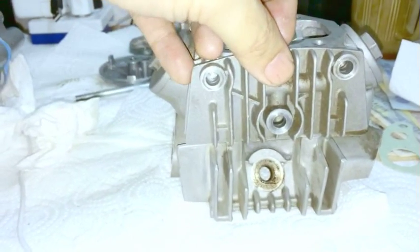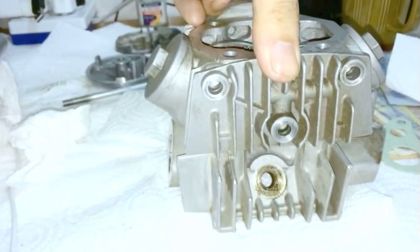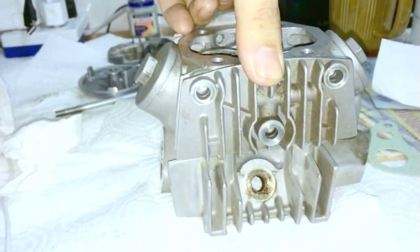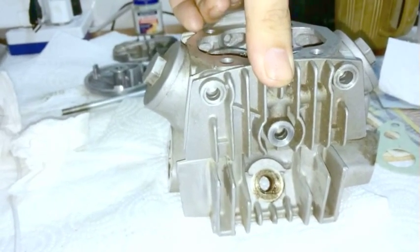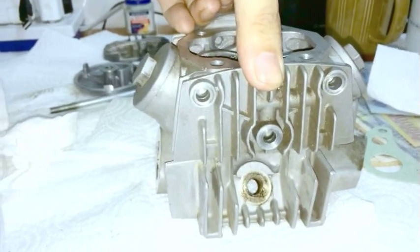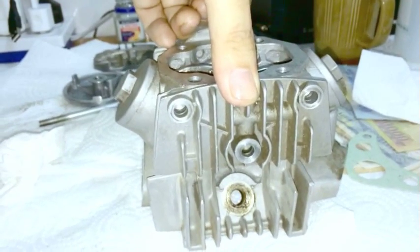Also, oil coolers disrupt the oil flow rate, and they disrupt the warm-up time too, because it takes a lot longer for the engine to warm up all that oil. It will keep it cooler for longer, so you might actually do your engine more damage because it doesn't heat up quickly enough. That's just one of those things. So in case you were thinking you really want an oil cooler, not unless you are experiencing overheating problems, like me, where I was in really slow traffic with no airflow, and it was very hot, 40 degrees C, and of course the pavement was even hotter. I did get occasional overheating problems, but you should be fine as long as you get some sufficient airflow over the engine. That's just a note over here.